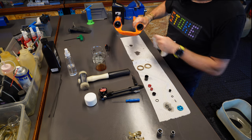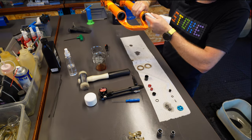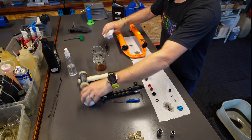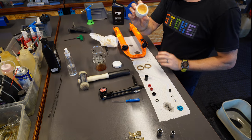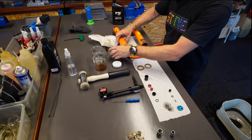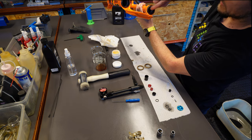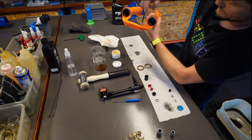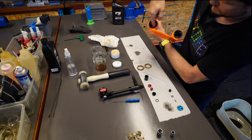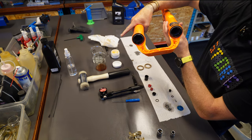To make life a little easier, clean out any leftover oil from inside the gland of the wiper carefully. Then take some suspension grease designed for seals and put a little bit into that gland, wiping it all the way around to get a nice even film around the entire wiper.